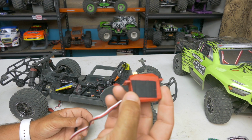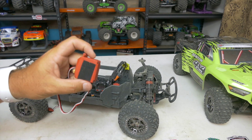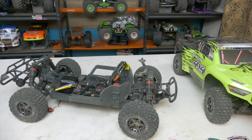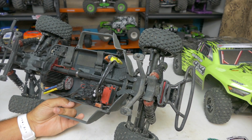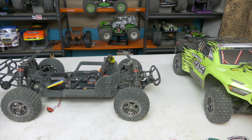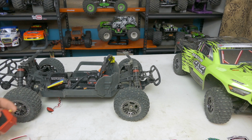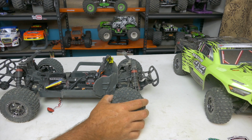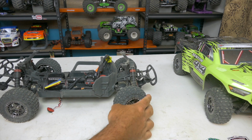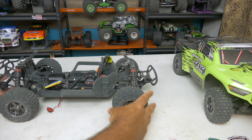But you can see I had it all set up to race. It kind of gave us a bit of a fit right before all the racing started, which was crazy. We'd only run it in the backyard, and I'd done the speed test with it, and that's on the green one. It's the first one I ran, and I had the issues with it. I noticed it when I was putting my laps on there, and the wheels were off, so I set the trim all the way left and it straightened. But the more that we ran it, it would never do anything but go fully right. It wouldn't adjust, or even with the controls allow it to go left at all. I recentered it and everything, took it all apart, put it back together with everything centered. After turning it on and letting it center the servo, same thing, hard right.